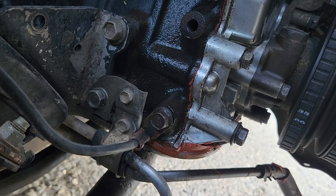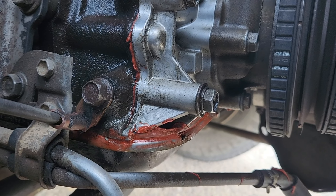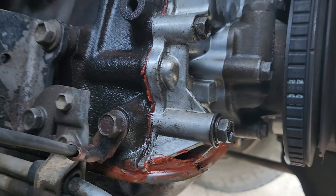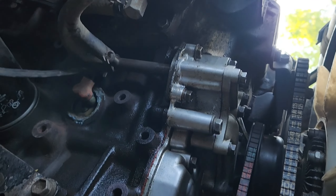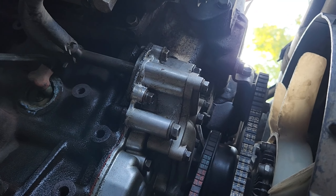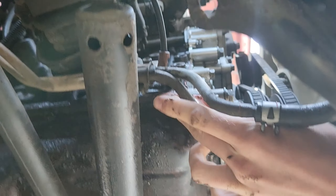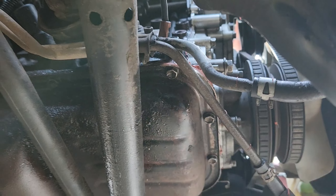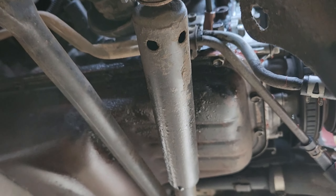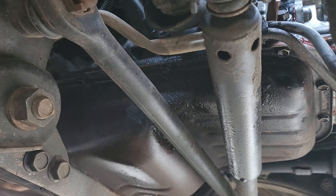Well, it doesn't look like it's dripping. And if you come in from here, there's no drip on the bottom of the oil pan. It's still wet up at the top, but that's because it's leaking from all the way up there. Apparently these timing covers are really not easy to seal — they're pretty prone to leakage. But from under here, that's pretty good. There's nothing really there. There's a bit behind it, but that could be a pre-existing oil pan leak, because as you remember from the original videos, this thing was absolutely covered in oil.